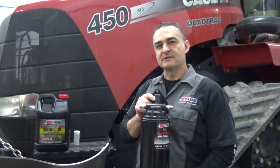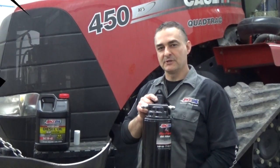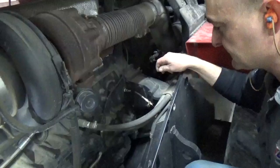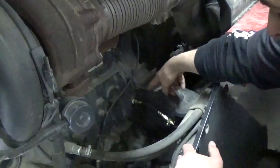We're going to get started — I'll show you where to pull that sample from. There's a plug right here on the back of the block, right by the flywheel housing. It's a 3/8 pipe thread plug and that's an oil gallery right there. I took that out, put in a bushing — this is just temporary to take a sample before I put the bypass system on. This is going to be the source of my pressurized oil to feed the bypass filter.